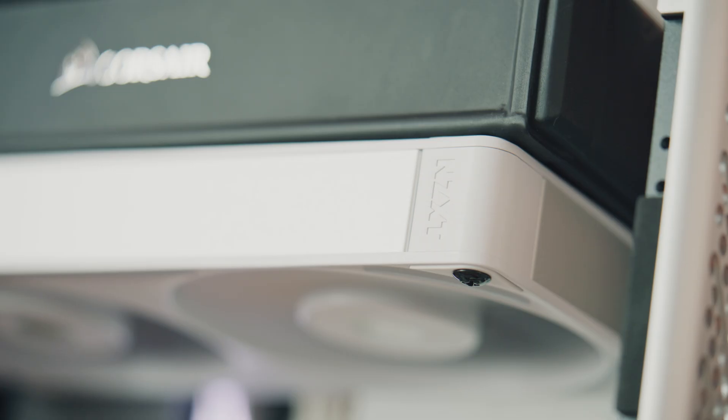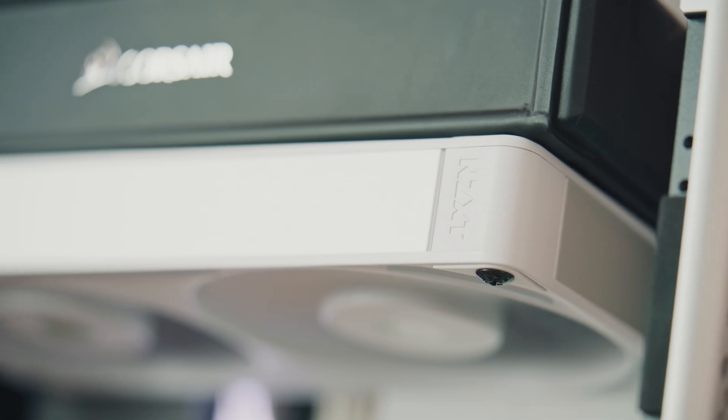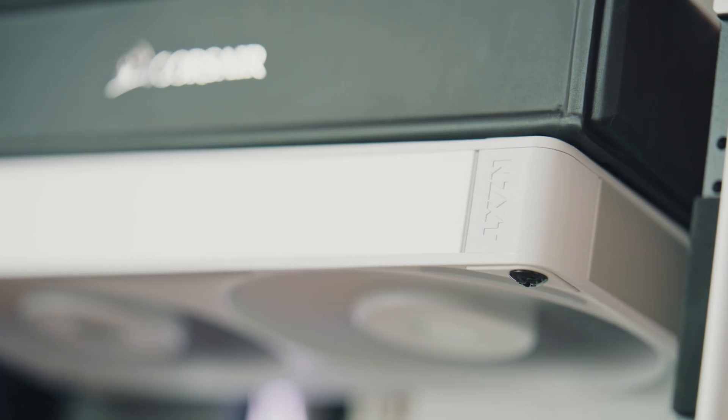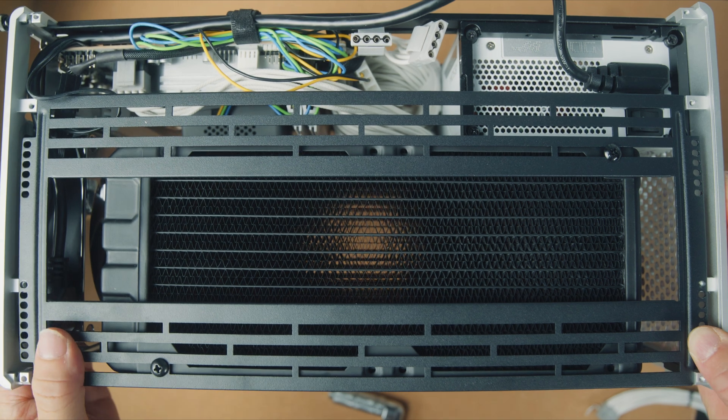For the launch review, I wanted to focus on the 120mm version, and later I will have testing to share for the 140mm. I mounted the F240X single frame version in the NCASE M3 custom loop I built recently. That uses a 54mm thick 240mm Corsair XR7 radiator with a 285K CPU pulling 225 watts, which should give a very good indication of how these fans stack up versus established performance options. They're set up as a top exhaust, pulling air through the case panels and pushing it up through the radiator.